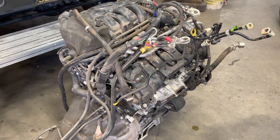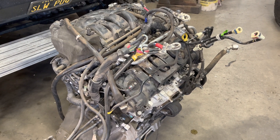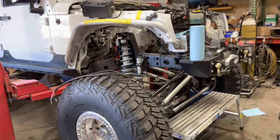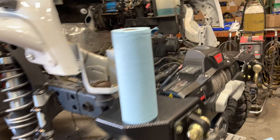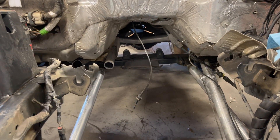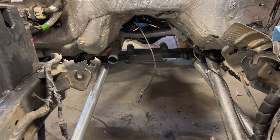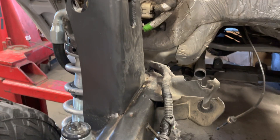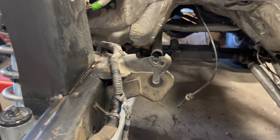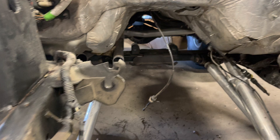So we're going to do some videos and a little bit of talking on this Jeep that we're doing this conversion on. This is the Jeep that we pulled the engine out of. The nice thing about our bolt-in motor mounts is — like this one here, it's got coil-over brackets. The motor mounts usually interfere with the coil-over brackets, but on this one we're reusing the perches so we're not going to have that problem.